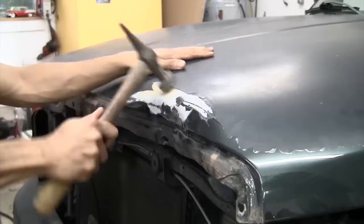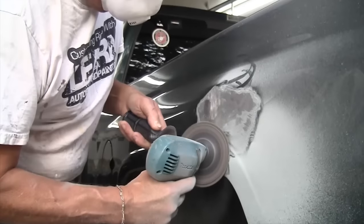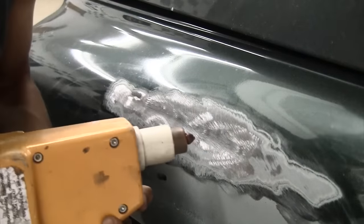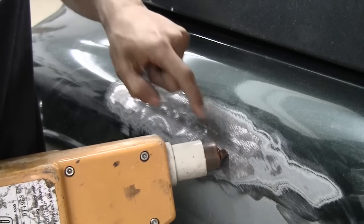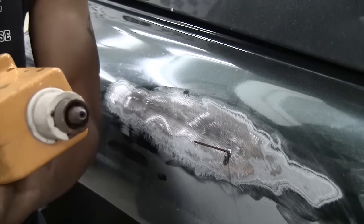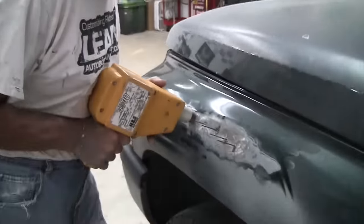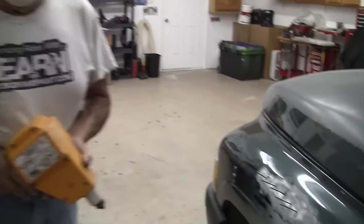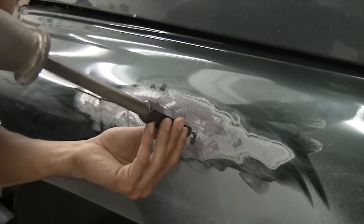It's on the bench. You wanna weld it in the crease. We're gonna do like four or five of them. You're gonna light that, and then you gotta push until this outer edge hits the metal. Then you're gonna squeeze the trigger for like a couple of seconds — like two seconds — and then you pull it out. Pretty easy, right? First time — not too bad for a 76-year-old. Push it in, you close it, but you keep pressure on it, because if you don't, it's gonna fall out.